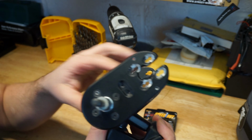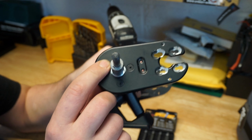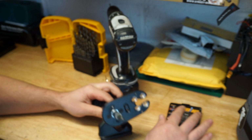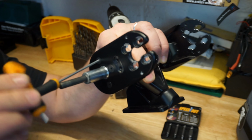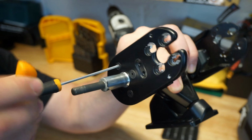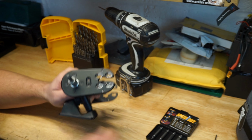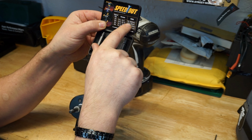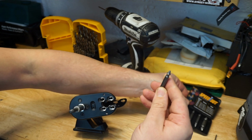So, the worst case scenario: the Allen bolt screw is now stripped inside your motor mounts. The Allen key to take it out does not work anymore, it just keeps on spinning. Now, this is an M4 screw, so looking at the diagram, number 4 to number 7, 5 millimeters is the smallest one. Okay, but we'll give it a go.